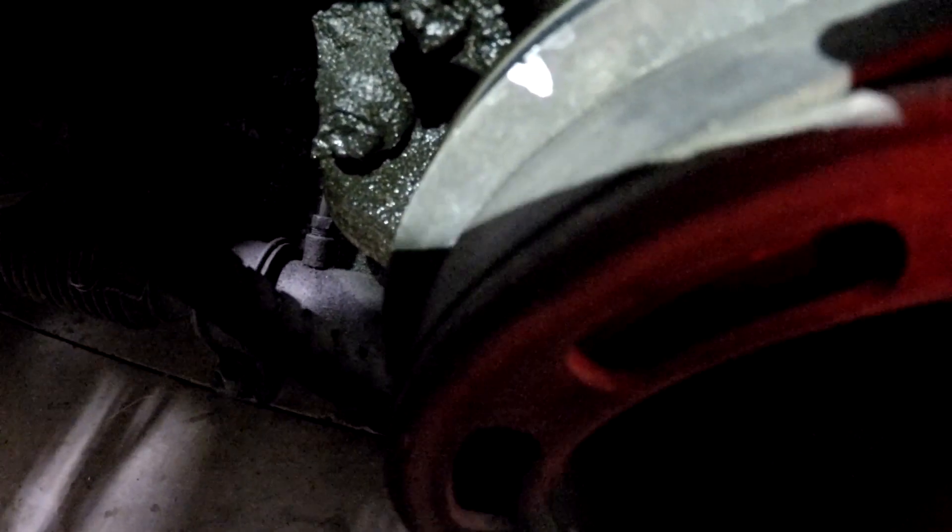Here's the pulley again with the whiteout marking that little cut. If you don't see the mark when you go down and look, you might want to go back to the driver's seat, crank the engine over, and bump-turn it a little bit, then go back and look for it again. Just keep doing that until you can find it.